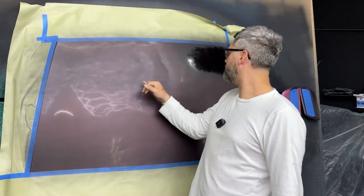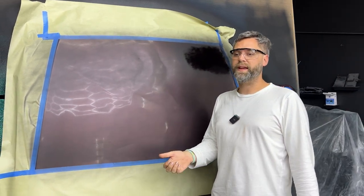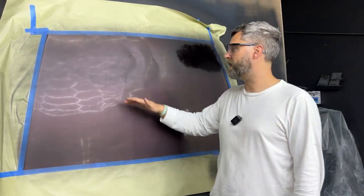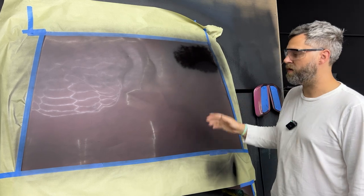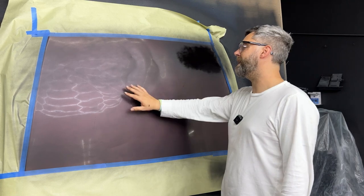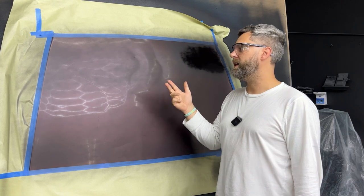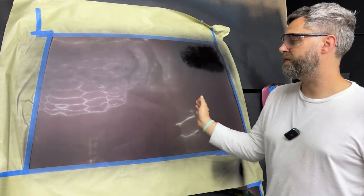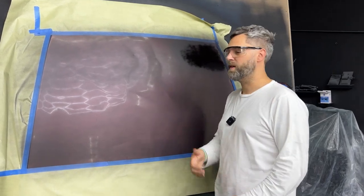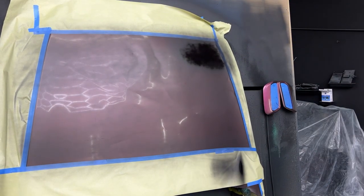All right, so moving on, once this fully dries, we'll move on to coat number 2. It's a little bit of a slower pace, but it's still considered a light coat. So I'm not gonna go again for that full color coverage, just a nice even coat all the way through. You can do panel by panel if you want, or you can do the full car length. I like to do panel by panel on the primer, either black, light gray, dark gray, and then do full color coats. That's full car length from the front of the car to the back of the car when it comes to your color coats. So pearl, solid colors, color shift, mega shift, you name it. So a couple more minutes and this will be dry.